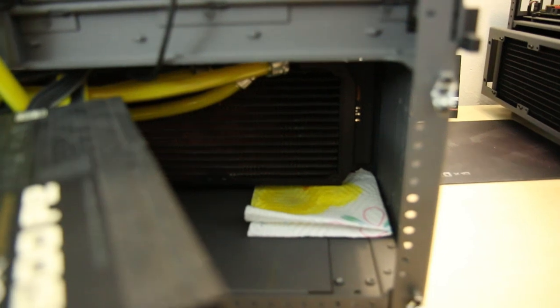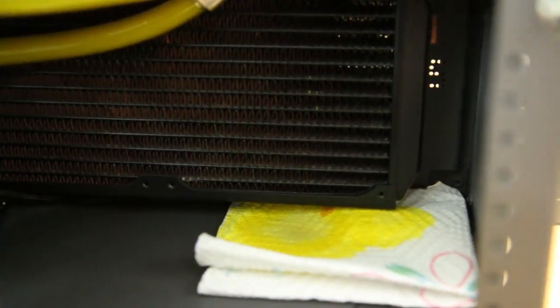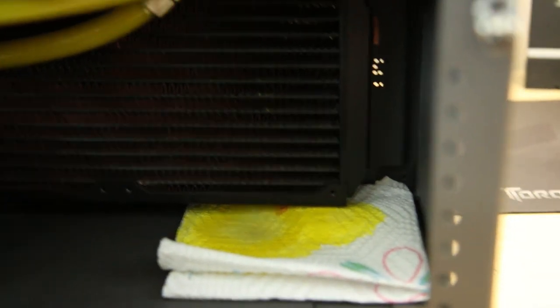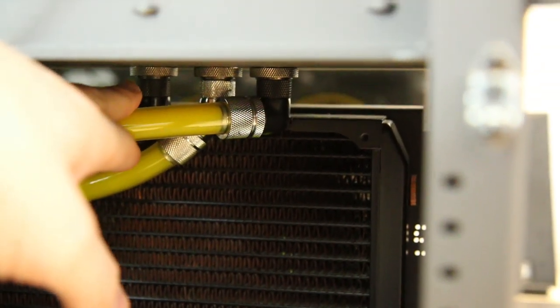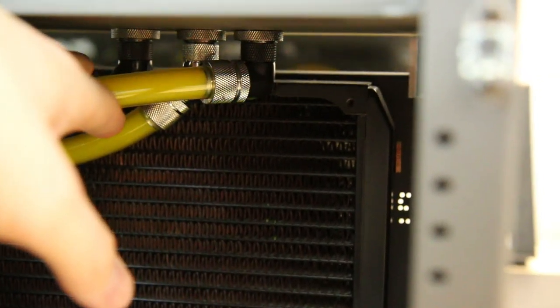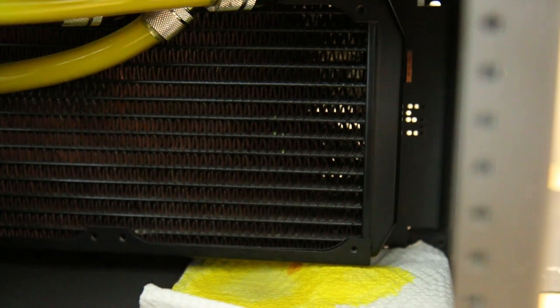As you can see, there's the proof in the pudding right there. I had suspected one of these fittings under here — one of these 90s — was leaking. Last night I cleaned it up and there was a drip in there, but I had a lot of tension pushed on this tube right here when I had my old cables in there. So I thought maybe it was just binding on that 90 degrees. I cleaned it up and it didn't seem to be dripping. So last night before my live stream, I put that in there to see if it was dripping, and as you can see, it certainly is. There's even a little bit on the radiator right there.